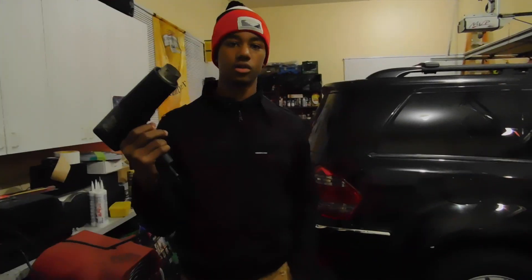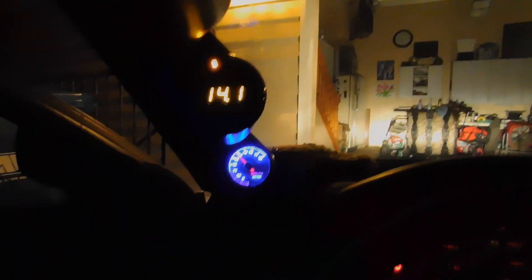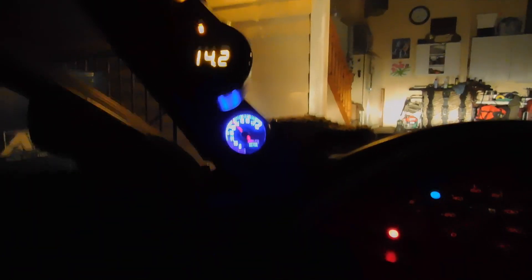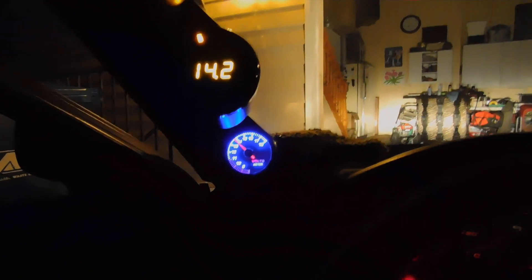I started running a little bit rough at first. I started it up, the wideband got heated up and it was at like 10.2 — it was rich as hell. I couldn't even — it was just sputtering. I haven't started it in like two weeks, so I mean that E85 could've just sat and got all weird. But it seems to be idling okay now. I might let it get up to operating temp and maybe drive it down to the gas station and back, and give it its last little cruise before this motor gets bye-bye.